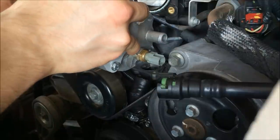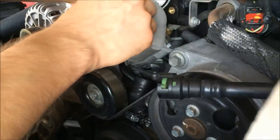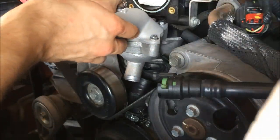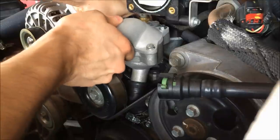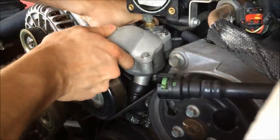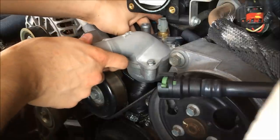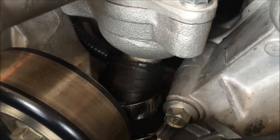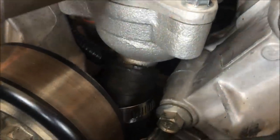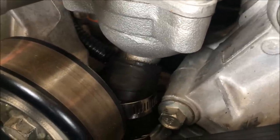To put this new one in, lay it on its side. Once you get it in there, turn it while you're going back, and put that end into the hose. Once that sits in the hose, line it up and put your bolts in. If you're having trouble getting that hose to slip on, you can put a little bit of radiator hose grease on there. That will help get it on, and if you ever need to take this off again, it will help to take it off.